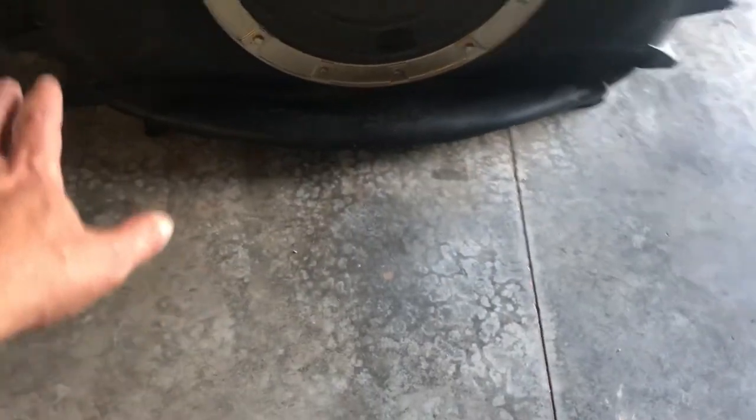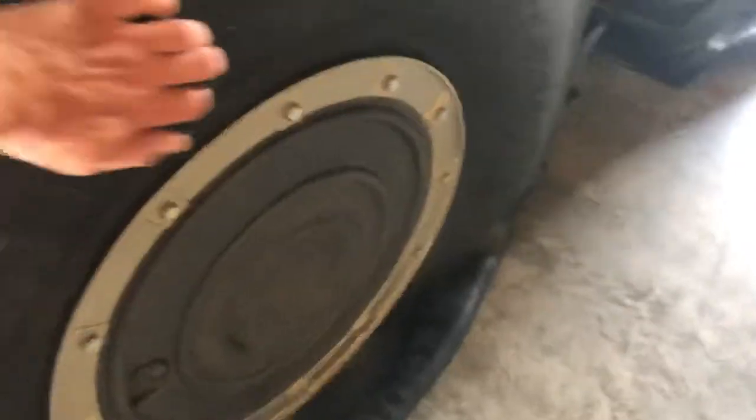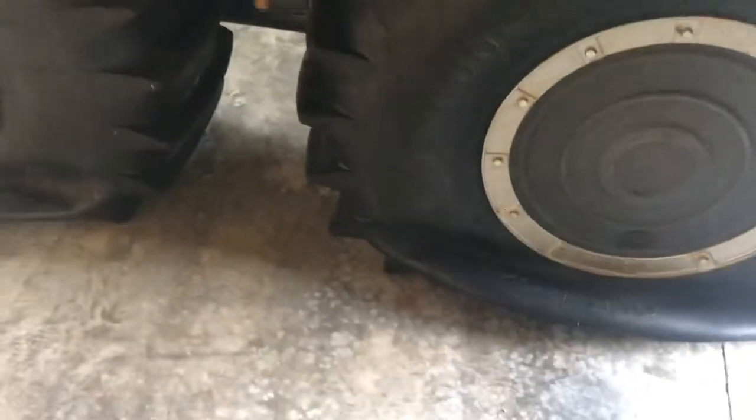Would you ever drive it with the tires this flat? Believe it or not, you would - in mud especially. If you're in deep snow, for instance, by being flatter the tires have a much larger surface area they're riding on, making them more floaty with more grip, because more of the treads are contacting the ground versus fully inflated tires. Additionally, these tires are also your shock absorbers - pressure on one tire is transferred to the other three, making the ride fairly smooth. Depending on terrain, you might just let out some air to make it a little bit smoother.